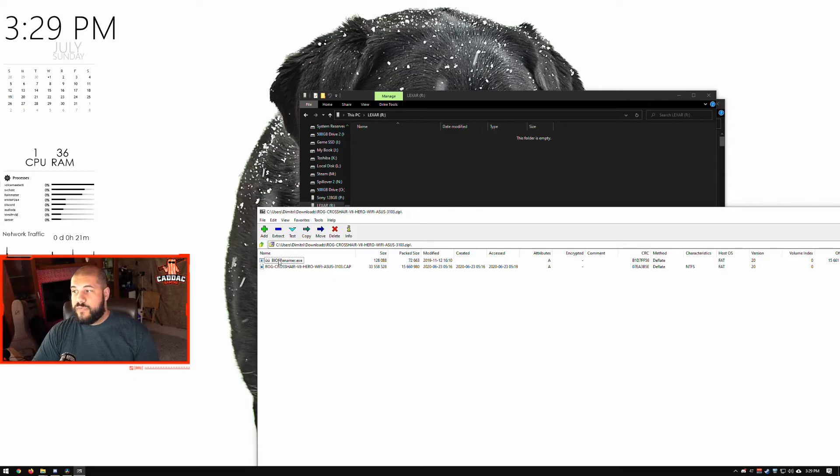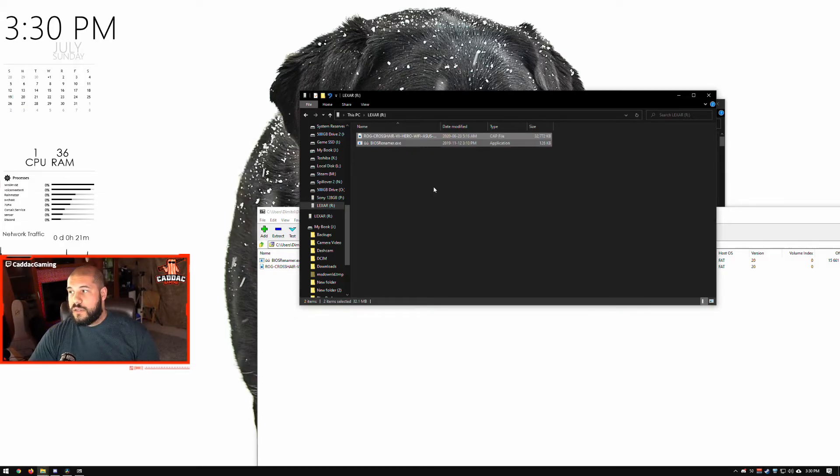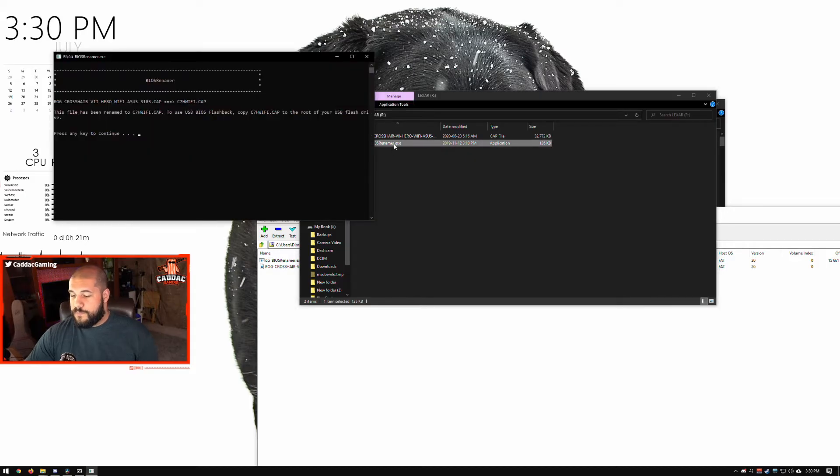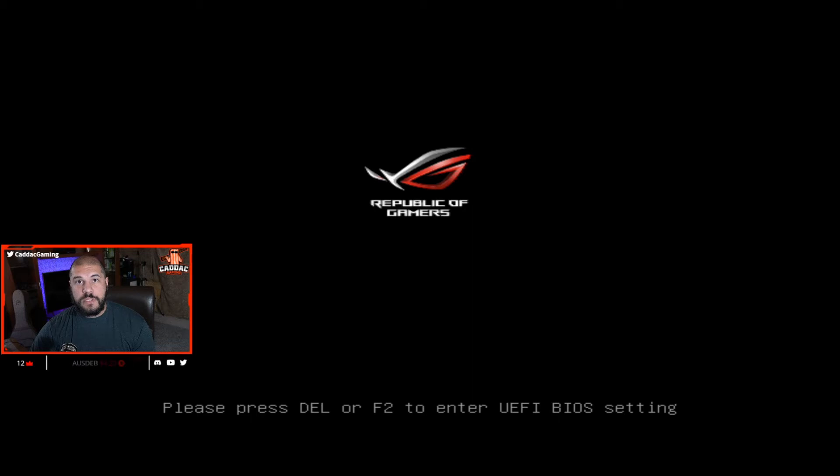You're going to move the files from your zip onto the USB. If you have an ASUS board, a lot of them do have these BIOS renamers as part of the zip file. What it does is rename the CAP file to whatever the motherboard is going to recognize, so you're going to drag them both over. If your BIOS download does not have this, you're not going to need it. Double check the description on your BIOS file and it'll tell you if you have to rename your file. It seems like a lot of motherboards now just recognize the CAP file immediately. If you do have the BIOS renamer, just double click it, click any key, it'll rename that file, then you delete it. Now go ahead, eject your USB, and restart your system, booting into the BIOS. You can spam the delete button until you get into your BIOS.